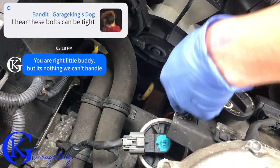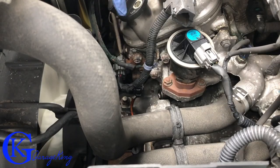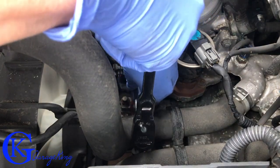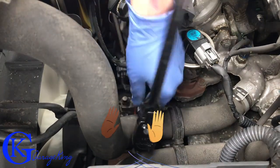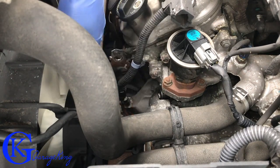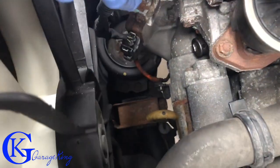That is one tight bolt. Let's undo the wires on the side here. My socket is still on there — it's really difficult to position. What I'm going to do is take off this bracket so I don't push against those wires. It's a 14 millimeter bolt right there. There we go — now these whole wires can be moved out of the way to give us much more room for the starter.